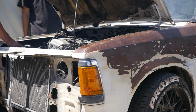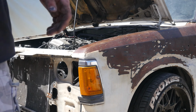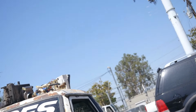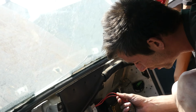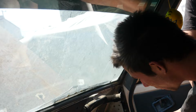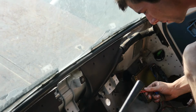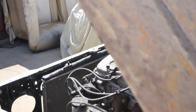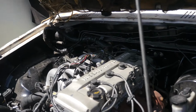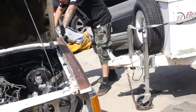Hold it pretty good inside the cabin if you want them to take a look. So inside the cabin, we just have it temporarily wired up, got me holding everything together. Main power, starter signal, ECU powers. The battery just fell over on me. But we at least know that everything to the motor is getting its right power, and the motor's good. So now we can finally do our job that we originally came here for, to wire everything up and get her back on the road.